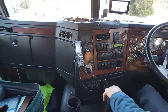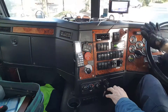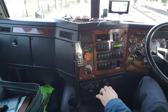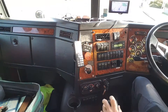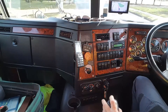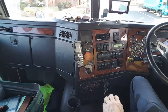Low range — waiting for traffic. In first, first, second, third, fourth, fifth, sixth. If I wanted to use the splitter, I could go overdrive — take the foot off the accelerator, put it back on, and I'm in overdrive. If I wanted to go back down with the splitter, take my foot off the accelerator, give it a bit of rev and match, and we're in direct.